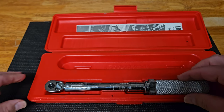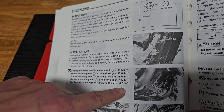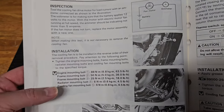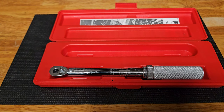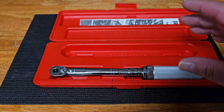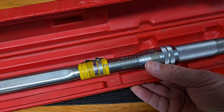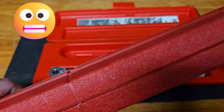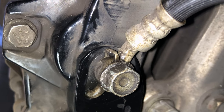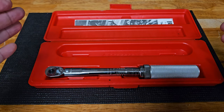The reason I really wanted this torque wrench is that there are times — just randomly picking from a motorcycle manual — where you've got four-and-a-half foot-pounds or 48 to 50 inch-pounds, and you need a lightweight application for certain bolts that the larger torque wrenches won't handle. As a weekend warrior when I was younger, there were times I'd misread torque specs — say it was 30 inch-pounds and I'd accidentally have it on 30 foot-pounds and snap a bolt right off. I remember doing it on a banjo bolt on a Honda where I just kept torquing until it spun the head right off.